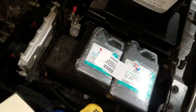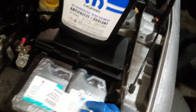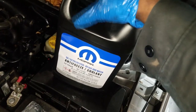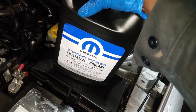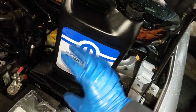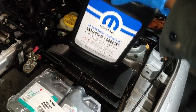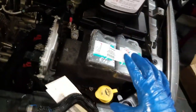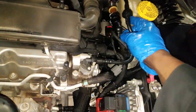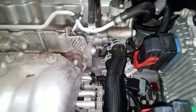I'll replace the hose and flush the cooling system — during winter I call this winterizing the cooling system. You want a strong, concentrated antifreeze in your car during winter. Antifreeze prevents freezing and also contains additives to prevent corrosion and keep the system clean. Regarding mixing 5-year and 10-year antifreeze: I don't recommend it, but if you accidentally add a little, don't panic — it's not a big deal.